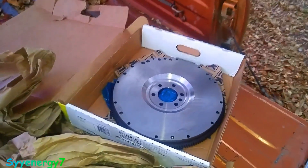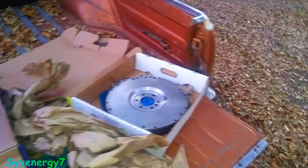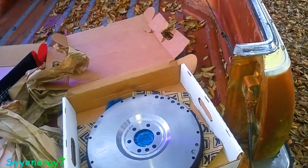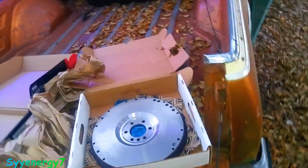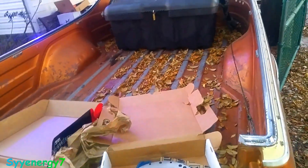I gotta order another flywheel right now — Chinese flywheel, God. I think the one I got, if I had a high horsepower engine a long time ago, it would have blown up because there's all kinds of heat-check cracks in it. Back in 1993 I just took a piece of sandpaper on a block and did a bunch of sanding in an X pattern, put the clutch in it, and it's been in there ever since — 25 freaking years.